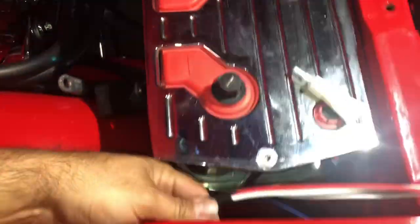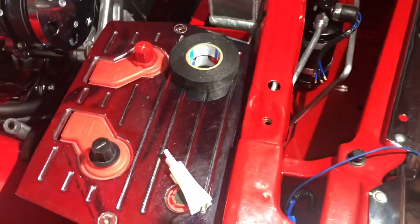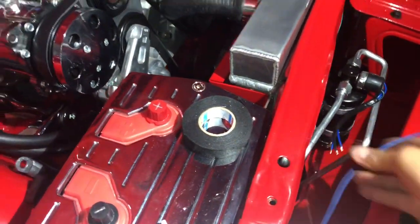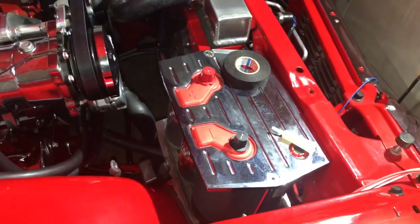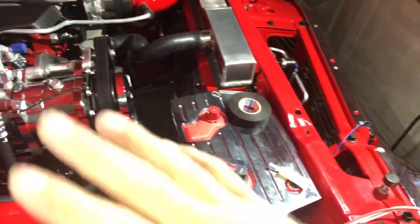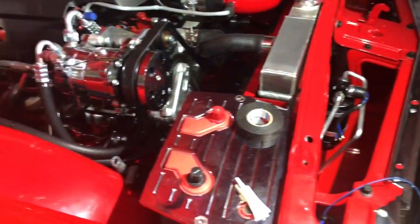They are right here. So now I just gotta connect them. This blue wire is gonna go to one of the wires over here. So I'm gonna wire up the control panel, and then I'm gonna come back and wire this, which is easy. It's just power, ground, and the switch. Then I'm gonna wire up the fan to the whole AC system. I'm gonna show you how to do that, and that's part of it, that trinary switch. So I'm gonna start with the control now.